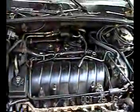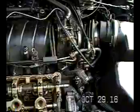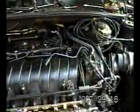Now one thing about the intake manifold is I believe the manual says to remove the fuel rail and disconnect the fuel lines and everything, which are right here. When I replaced the plenum before, I didn't do that. I didn't disconnect the fuel lines. What I did is I used a bungee cord and I suspended it from this latch here, and you'll see that probably in the next shot, where I don't disconnect those fuel lines.